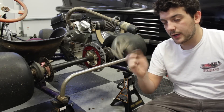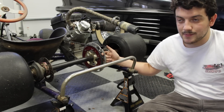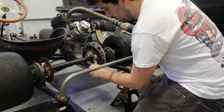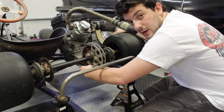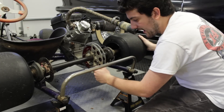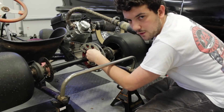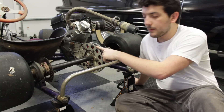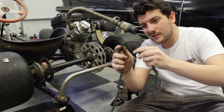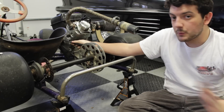Once you've tightened the chain, put the sprocket protector back on. I'm also going to straighten mine out since it gets beat up in the yard. Put the 7/16 nuts back on — not as tight as the hex bolts underneath the engine, but pretty tight; you wouldn't want these falling off. Now the sprocket protector is back on and we should be good to go. You might need to oil your chain if it seems to be clumping up. When you oil it, watch out — if you're sitting in your seat while there's oil on the chain, you're gonna ruin your clothes.